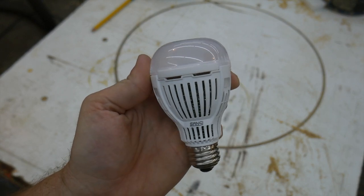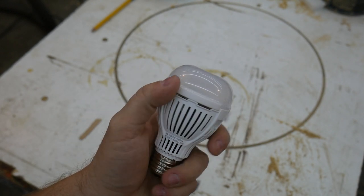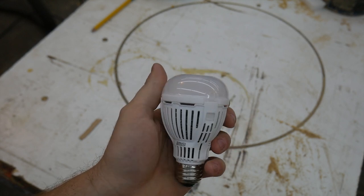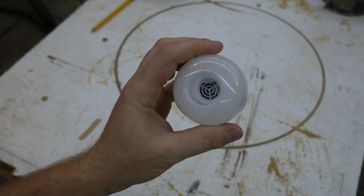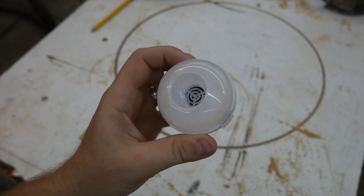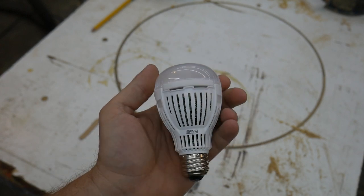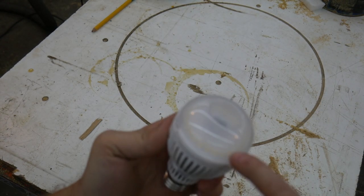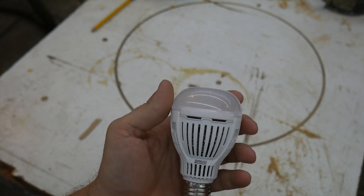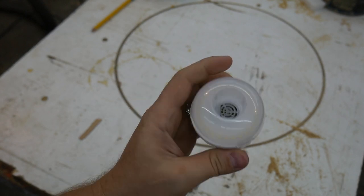If you look closely inside, you can see the circuit board — I had mentioned that previously. I did a little research about this ceramic spacer they put in their light bulbs. The idea is that an LED light can generate a lot of heat. The reason LED lights dim when they get hot is because the LED elements are attached directly to the circuit board — when they warm up, the circuit board warms up and causes inefficiencies in the circuitry. Anytime anything electronic gets warm, it becomes less efficient. So they put this big thick ceramic spacer in to separate the LED elements from the circuit board. The spacer helps absorb heat and shield the circuit board, resulting in a light bulb that stays cool and can also be used in an enclosed fixture without a reduction in performance.